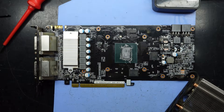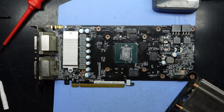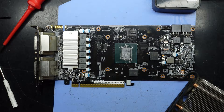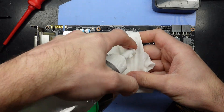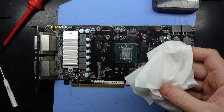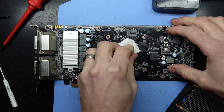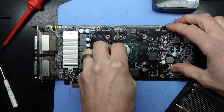With the help of some isopropyl alcohol and some tissue paper, should be able to quickly clean that up and swap it over. It should just be able to go over the chip — try to pick up as much thermal paste as possible along the way.